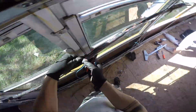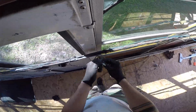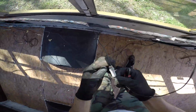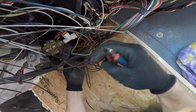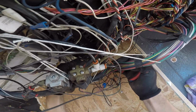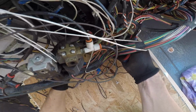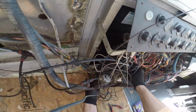And some of these wires, such as the one that ended up being to our lighted stop sign, sent us on a bit of a wild goose chase, and we had to go crawling under the bus, but it was a bit of an adventure. And you'll see if you look closely at our control panel why it's so important to trace each wire back individually, because there are maybe a dozen wires that could potentially be the same thing and have the same color, width, and that kind of thing.